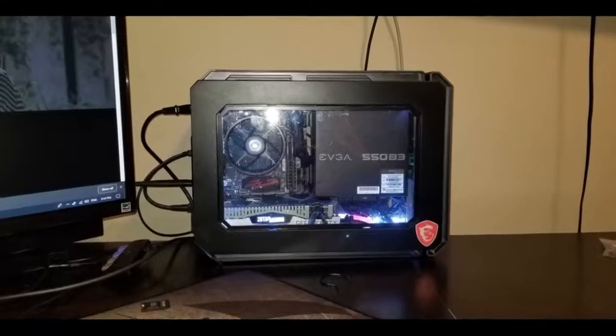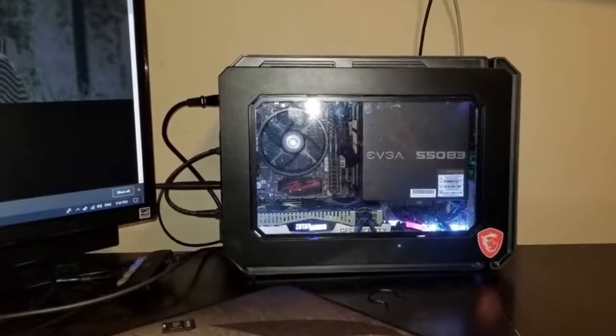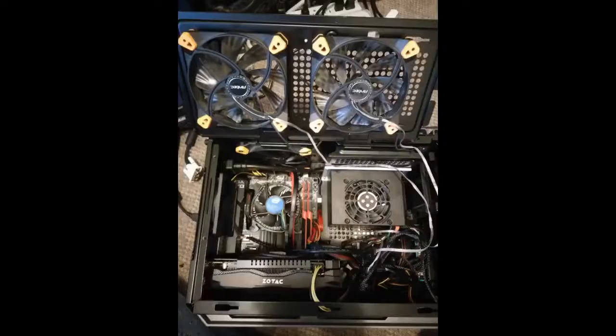Got this to build a small form factor artist's PC for my graphics display. It uses ITX mini motherboards from Intel and Ryzen. I tried a full-sized ATX power supply but it doesn't sit in the square slot for the power supply. I recommend you purchase an SFX power supply or a smaller size supply that will fit in this slot.